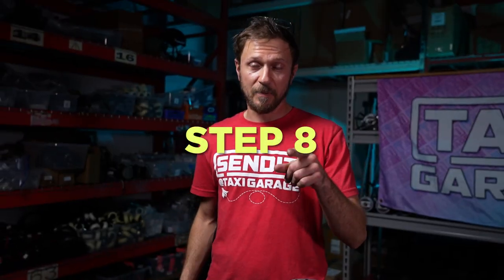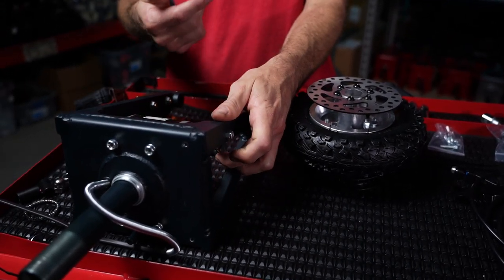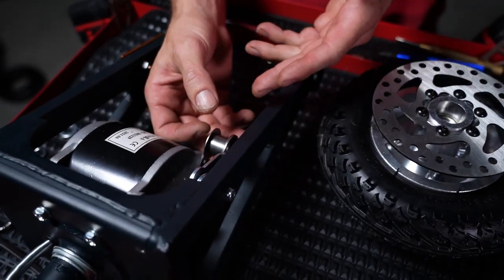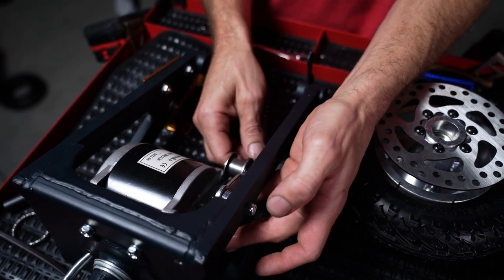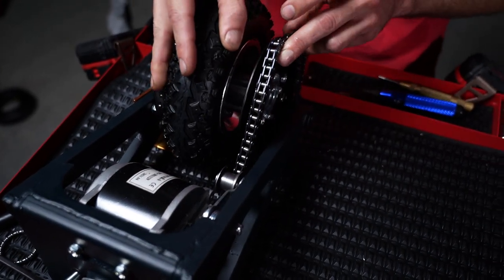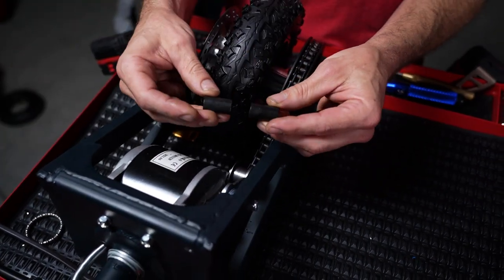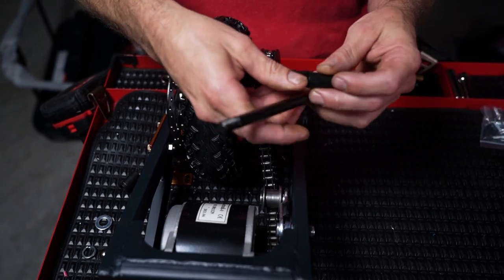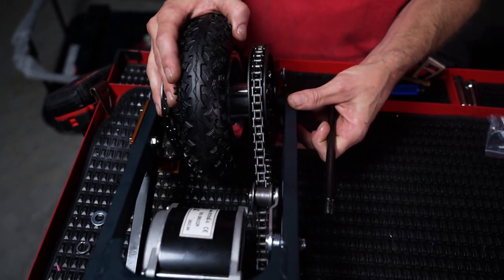Step eight: grab the XL fork with the brake bracket already installed and reinstall the chain and new wheel setup. Lay the fork so the tensioner faces toward you. Remove the spring from the tensioner to eliminate tension fighting you during assembly. Slide the chain under the tensioner, guide it onto the top gear of the motor, and start aligning the rim set-up back onto the chain. With plenty of slack in the chain, you can put the spacers back in and align the axle bolt much more easily.